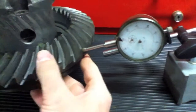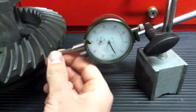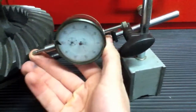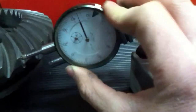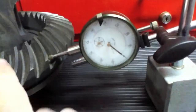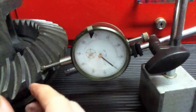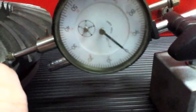I have a ring gear here — an old one — just to show you how this works. You can push the plunger in as far as you need to, then walk it up and place it where you want. Then you can reset the whole thing to zero from wherever it was. Now the gauge is back at zero, the plunger is touching, and when you move the gear back and forth you can tell how far it's moving.